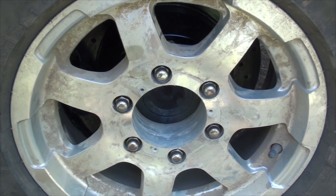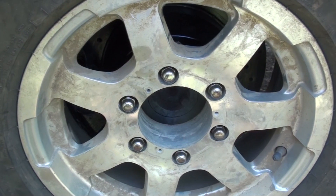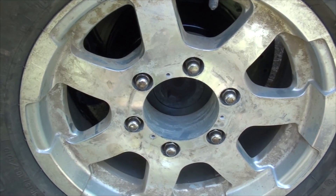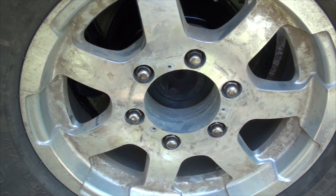Day number three. Things were going smooth as I shaved down my calipers — that's right, I had to shave down my calipers, and next I'm going to have to shave down my yoke. These 15-inch wheels worked perfectly with the last axle I had on the van, but not so great with the new axle. You can see they turn freely now, but I did have to shave a tiny bit off my calipers to make them not rub.